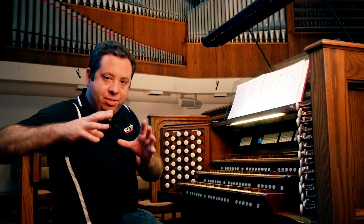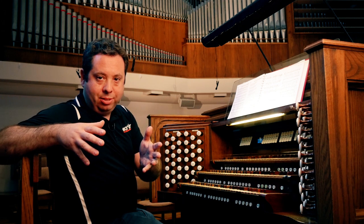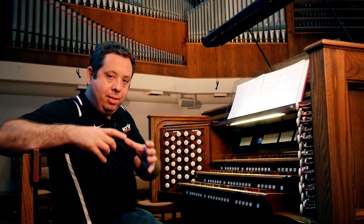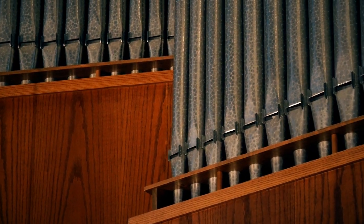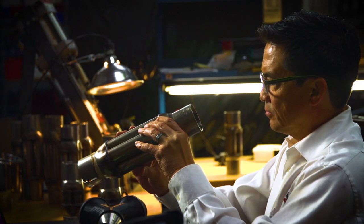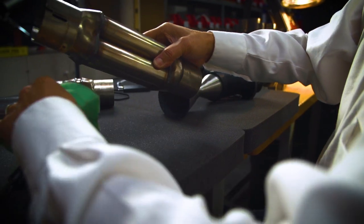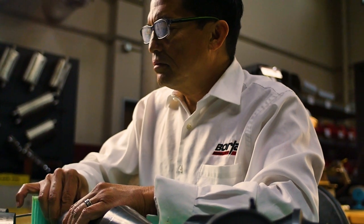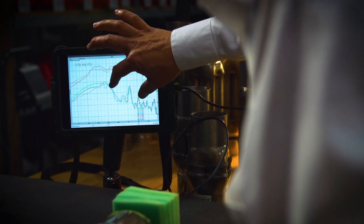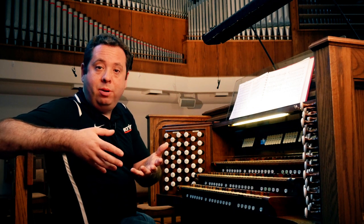Borla's polyphonic harmonizer is actually based off centuries-old pipe organ technology. A pipe organ achieves different notes by varying the diameter and length of the pipes. But those diameters and lengths are not chosen arbitrarily — you can't just play any random notes together. Particular notes sound better together than others, and musicians spend their lives learning how to maximize these combinations to create different sounds and elicit different emotions. We can do the same thing with an exhaust system.